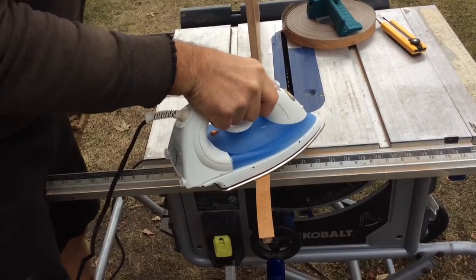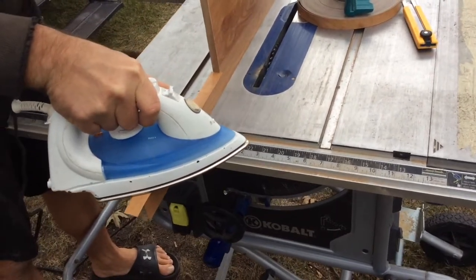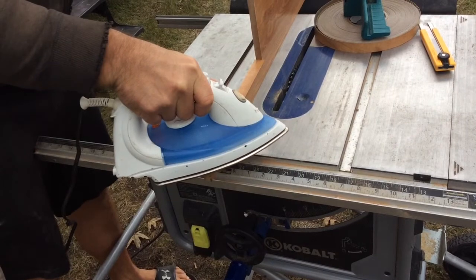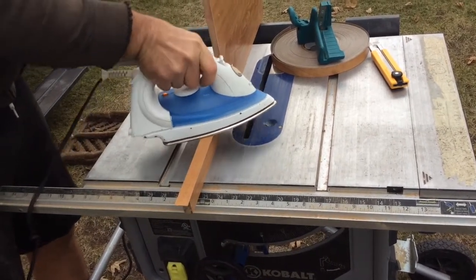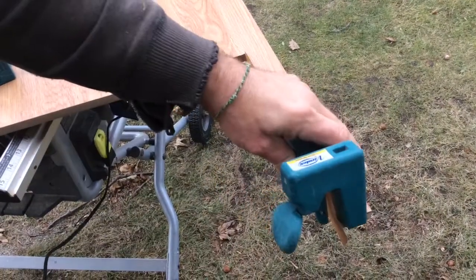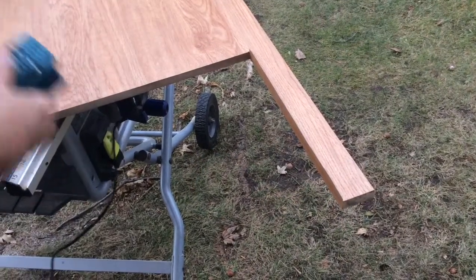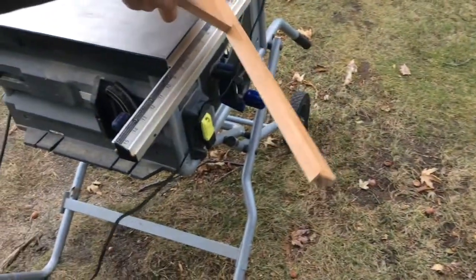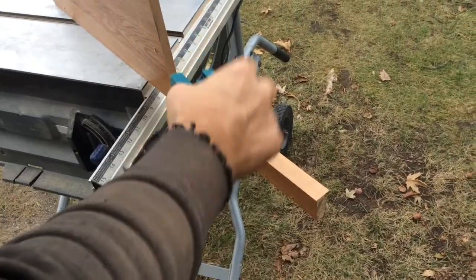With this pre-glued stuff you just have to take your time and make sure the glue sets fully. Lee Valley makes a couple of nice tools: this one makes a nice 90-degree cut along the edge so you get flush with the piece of cabinet, and this one is a double-edged trimmer with knife blades on both sides. The problem with this kind of situation is you can't go into a blind corner, so I'm going to run this cutter up as far as it can go and then come back the other way.